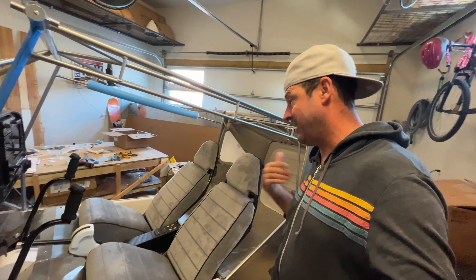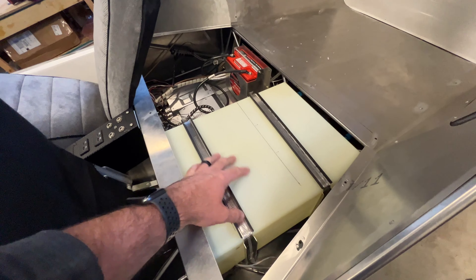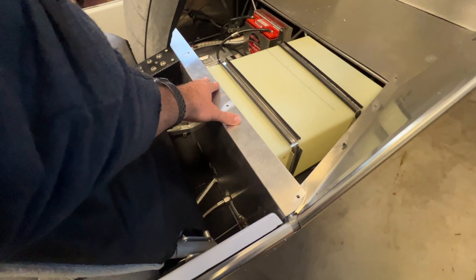Let's talk about where to start in this phase of the build. Assuming you're done with the rear baggage floor and the station four closeout, the next place to start would be the header tank. The trick with the header tank that I found is knowing when to screw in the fittings. I had the front fitting on and potentially the bottom fitting on, but not the rear two — you're not going to get it past the station three bar to fit it in. Once that's in, then you can screw those in.